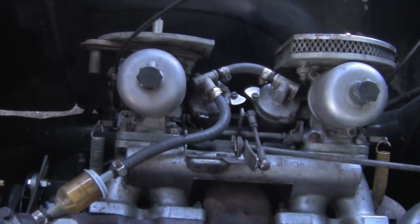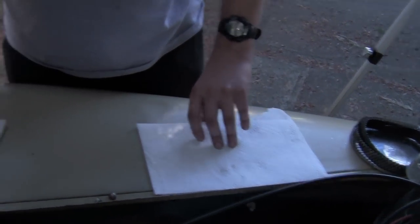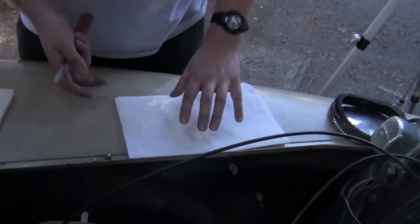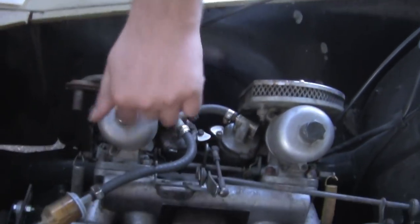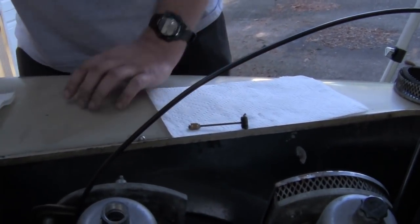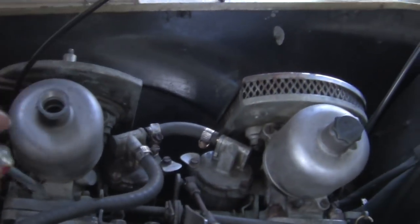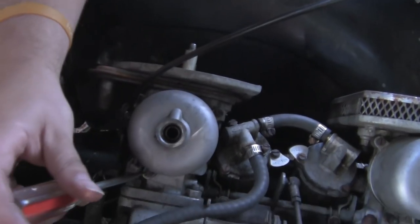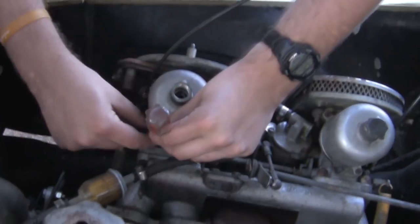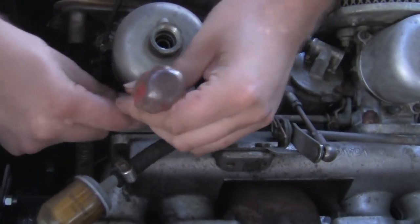We got our air filter off, and now we need to take the dome of the carburetor off. I have some paper towels here to keep everything clean — I like these paper towels that come in half towel size because you can fold them in half; they're just easier to deal with. We'll unscrew the dashpot valve here and set that on the towel to keep it clean. Then we find the three screws and just undo them. Be careful not to drop these because they will drop and it's not fun.